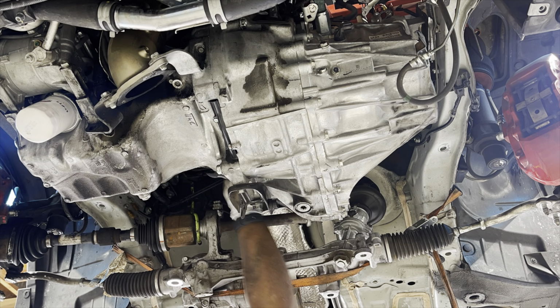Motor's cradled up, so go ahead and pull the transmission mount off. Get this transmission pulled out. You can see we got the rack ratchet strapped up out of the way, and we got the axle bungee corded up out of the way as well, out of the transmission. If you guys are doing this at your house, make it loose. It's a bit of the process right here.